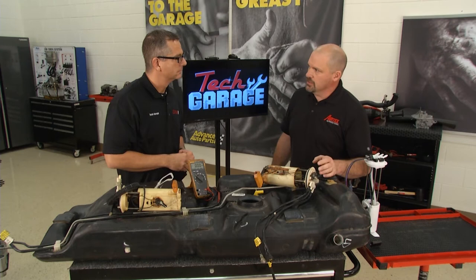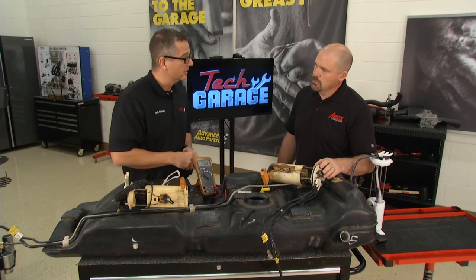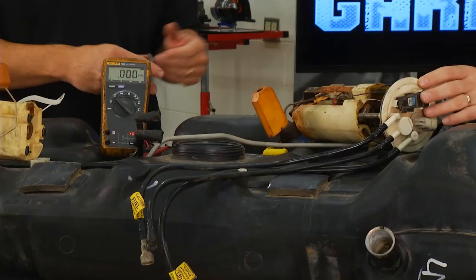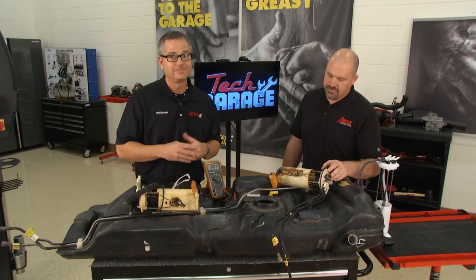We current ramped one earlier and had about seven to eight amps of electricity. If that starts to get clogged up or the fuel filter clogs up, that's going to make the pump work harder — the amp draw will go up as those problems increase, because of the mechanical resistance. Now, why aren't we catching fire with the pump submerged in gas? Well, first off, gas does not transfer electricity. And also, because of the fuel vapor, there's not enough oxygen in the tank to sustain an explosion.